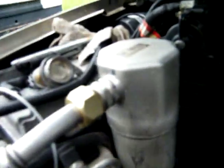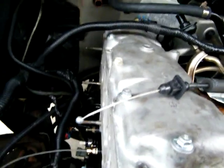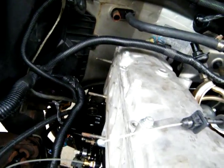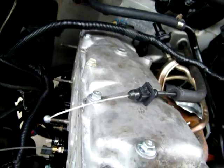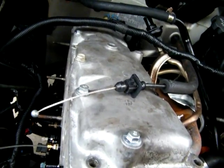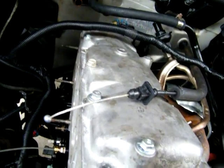I gotta try to get that back in there now. Maybe I can spin the motor without having to put all this back on. If I can spin the motor, what I'll do is pull the plug, spin the motor with the cap off, and see if we get any oil up here at the top — and that's before I take this thing completely apart and pull it.